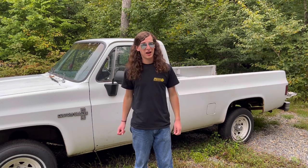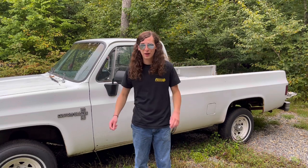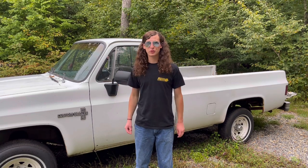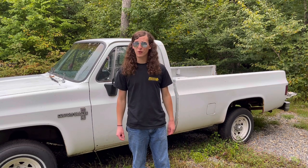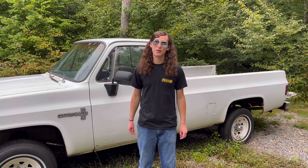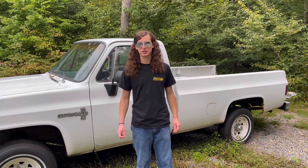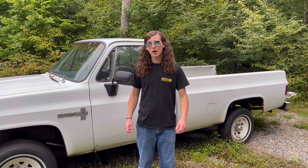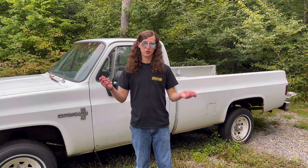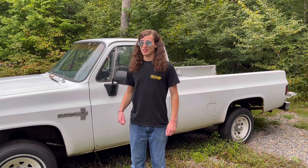You see, when we were in Kansas, we were just cruising her down the highway in third gear or full pull, sending her down to Pennsylvania. And all of a sudden I said, man, this truck just does not feel like it's running right. And I pulled over and it was just shooting coolant out of the heater hoses, which was nice. Luckily, we made it home by putting a 160 thermostat in there, and I didn't really think anything of it until I pulled the dipstick on her and I started seeing it was looking more and more like chocolate milk, which leads me to believe that we blew the head gasket in this old girl here.